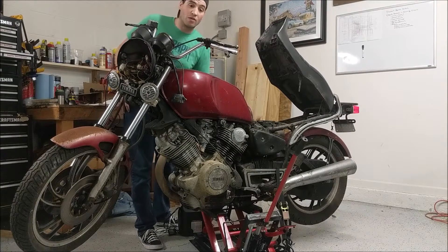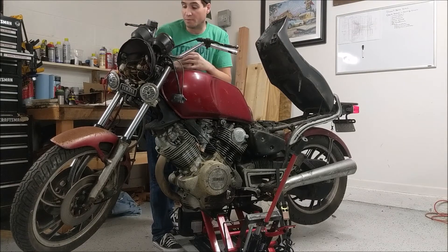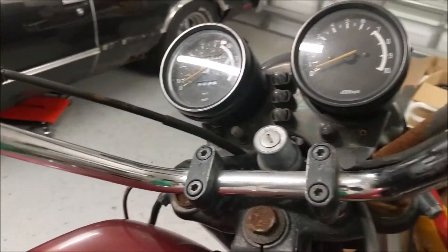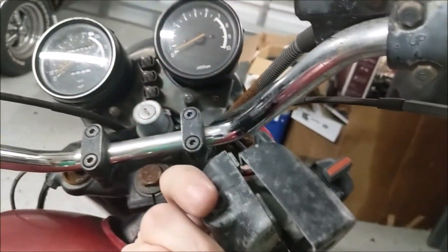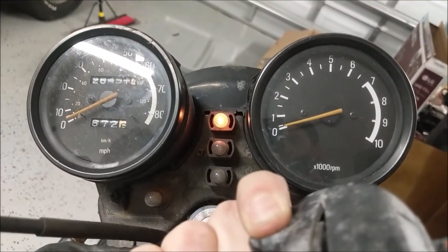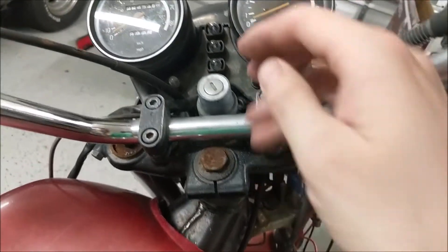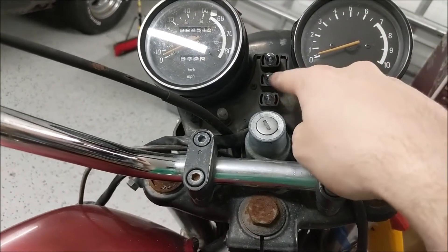The oil level switch light is coming on but I don't have a neutral light, so it could be the bulb is busted or the neutral switch isn't working. Here's how I'm going to check the neutral light: I know that whenever I touch the starter button, the low oil light comes on — so I'm going to swap that bulb for the neutral light and see if it makes a difference. I switched the lights, hit the button — still doesn't work. Both bulbs are good since I verified each one. So I don't have a working neutral switch.